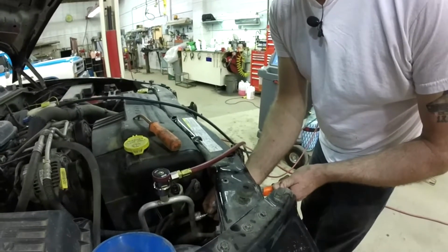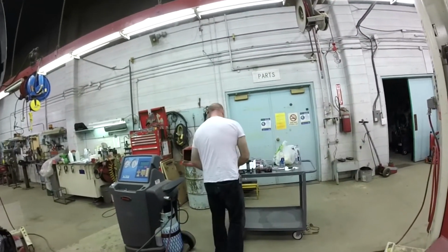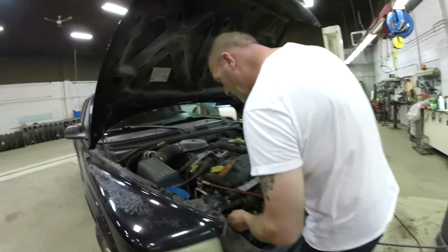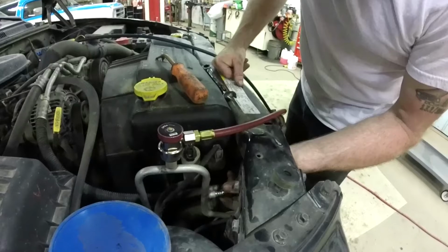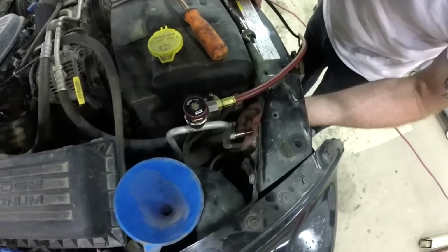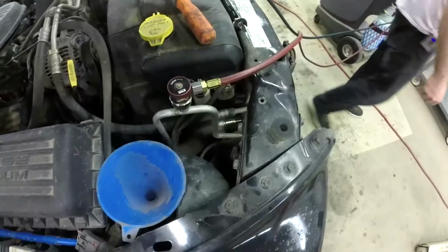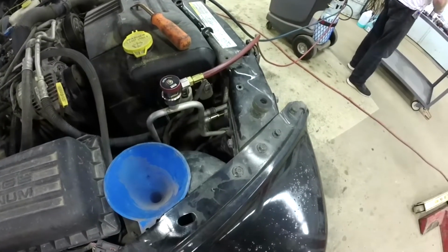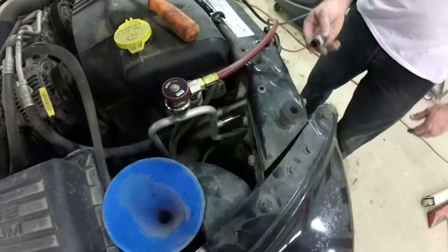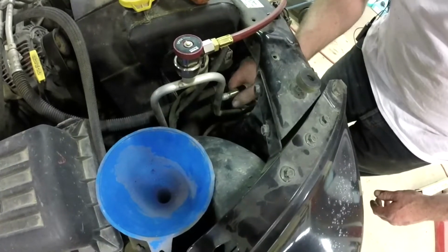See, I'm introducing a leak right now, and you can hear the compressor vacuum pump just working away. Now we can stop it. So Schrader valve is out. Now I can screw the first part of the sensor fitting adapter on. Screw on the second part. Hopefully we maintain a good seal. And we'll be laughing.